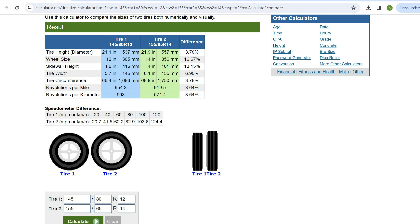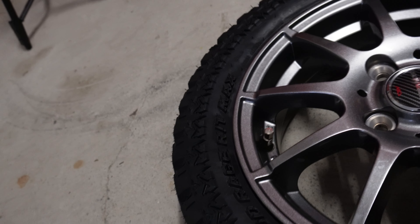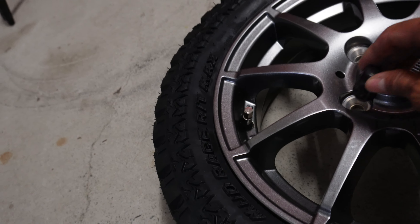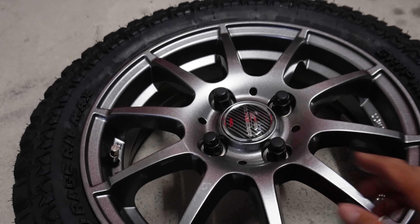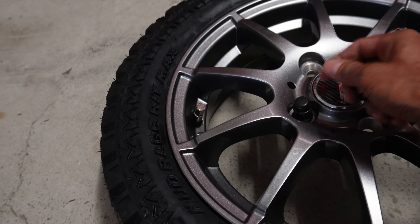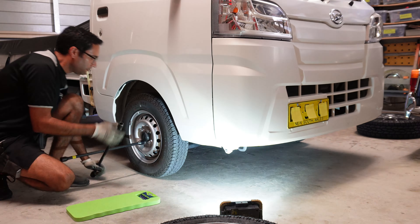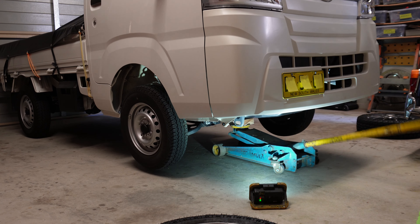The second image shows the wheel details. The main difference is the circumference — the new tires are slightly larger. The tire height is 3.7% higher, so about 2 centimeters taller. This also affects the speedo by about 3.6%. Currently the speedo overreads — at 60 on the speedo you're actually doing about 57 km/h — so the new tires should correct that and bring the speedo closer to true speed.